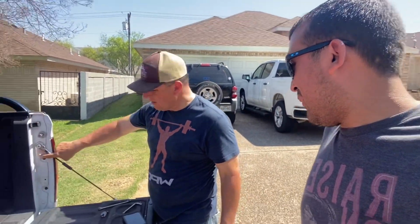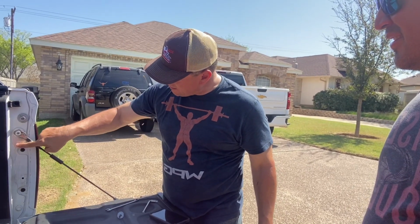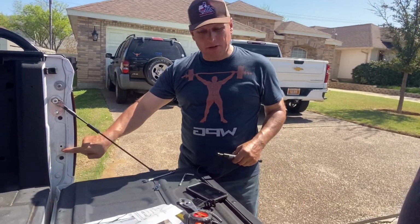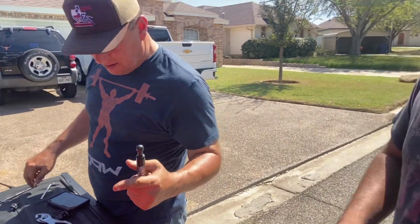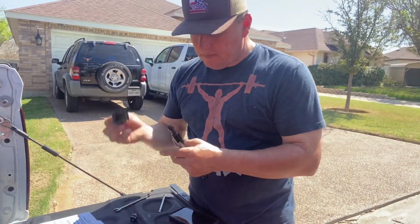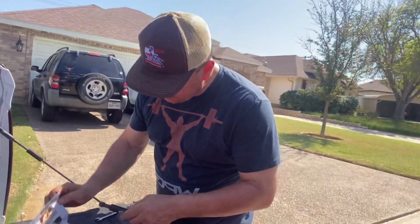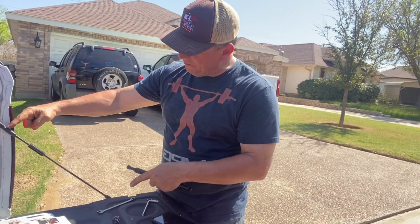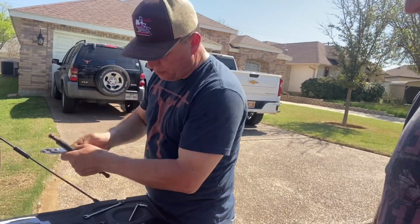Aquí viene the tailgate assistant. Here we go. Like I said, we put the bolt back, we put the harness that holds the tailgate, which has a little nipple here. We had to remove the little rubber bumper that was on there. Did you put that away already? Little black rubber. Oh, here it is. Yeah, we had to take this off. We also had a spacer that we had to install, 3.5 inches from the beginning of the cable. It kind of slides in. We had to use our pliers to press it down.